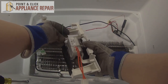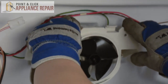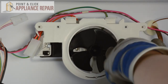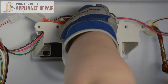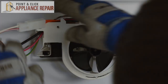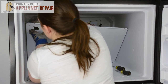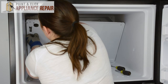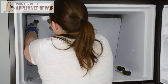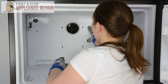We can reconnect the ground wire, then mount it on the wall again. We can replace the evaporator cover and start threading through the wire harness for the ice maker. Push it past the screws, and make sure that the fill spout for the water goes through the hole in the cover as well. Then we can replace the screws.